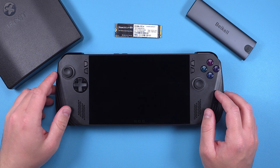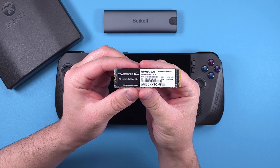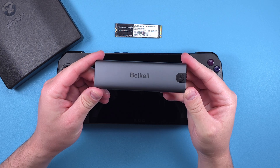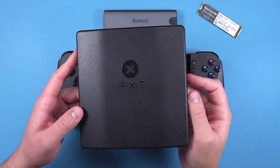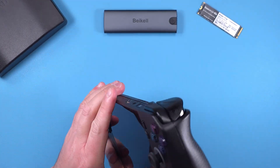Here's what you're going to need. First, obviously you're going to need an ASUS ROG Ally X. Next, you're going to need a new SSD drive. The Ally X accepts 2280 sized M.2 drives, and personally I'm upgrading to a 4TB drive. I'll leave links to this drive and others in the description so you don't have to worry about compatibility. You'll also need an M.2 enclosure for connecting the M.2 SSD to the Ally for cloning — this tends to go out of stock so I'll leave links to a few different options. Lastly, you'll need a Phillips Zero screwdriver for opening the device and a pick or spudger to separate the back shell.